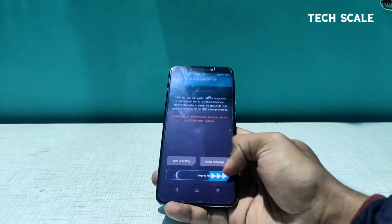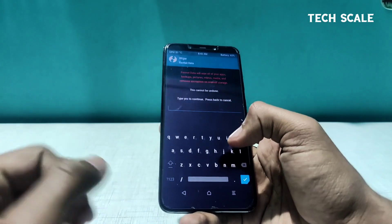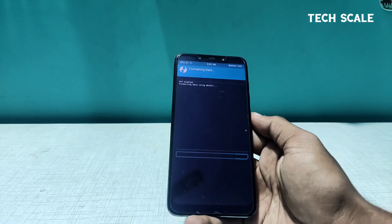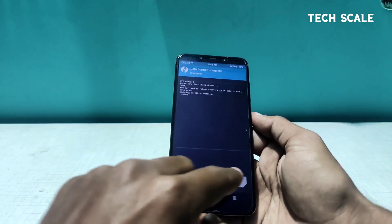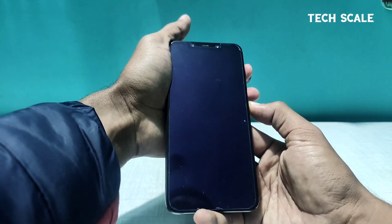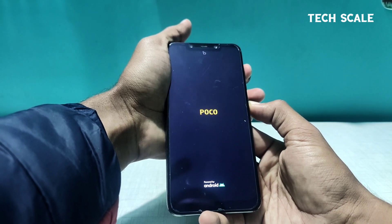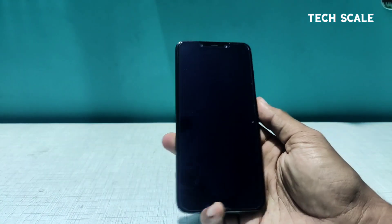I don't have anything very important in my phone, so I'll go to Wipe, Format, and type 'yes' — this will completely format your data and it will be totally wiped. After that, I'll reboot it again and press Volume Up and Power for five or six seconds to land in TWRP again. Just to let you know, the download link of the ROM is in the description.